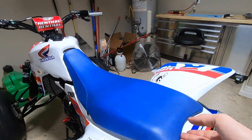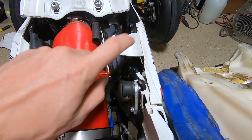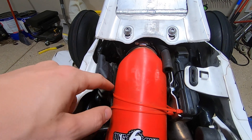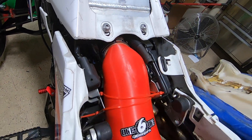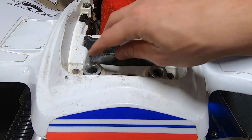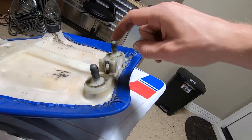We can pop the seat so you can see the intake. Here's our intake — it's a 161 Motorsport intake. Here's the ECU that has been reflashed by TDR Racing — Tim over at TDR. Here's the stock rectifier. This is a JB bracket. You can see the downdraft intake right there, and a little temperature sensor there. It still has the stock tool kit. The seat latch is gone — with the lowering kit, you do seat pins. You drill through and two pins lock in your seat instead of the stock latch.